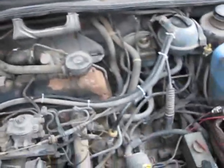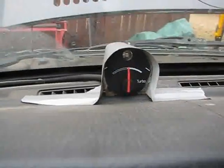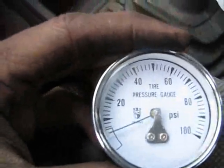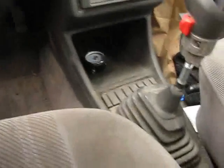I'm trying to sell that right now, and once I sell it I'll be able to buy a couple of gauges. I'm gonna buy a better boost gauge - I apologize because I've got the current one teed in and duct-taped to the dash and it doesn't have any markings on it. I can easily max it out. Before I was using a tire pressure gauge and I was hitting about 10 or 11 PSI. I want to be sitting maybe 16 to 20, but I've got to keep an eye on the EGT.